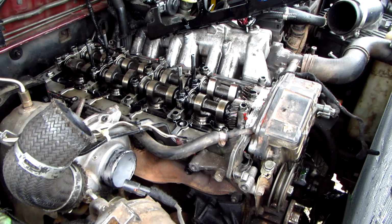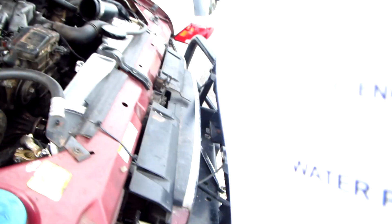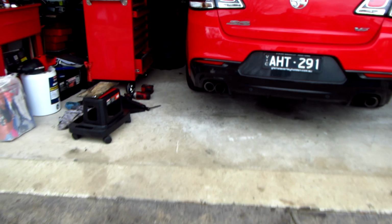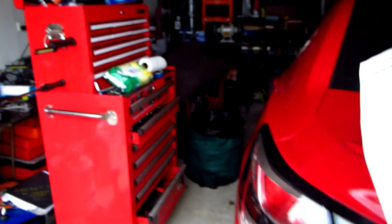And it appears as there's some coolant in number three. Now number three is down at the bottom, so I'll be surprised if that's the issue that's causing the engine to be locked up, but I'm going to have to take the cylinder head off, I think, by the look of it. So I'm going to leave that till it's dried up a bit, maybe tomorrow.